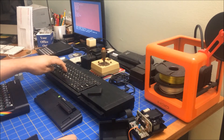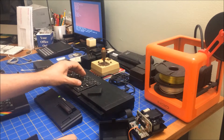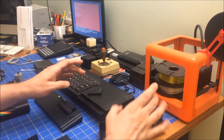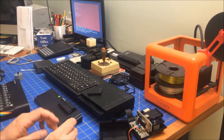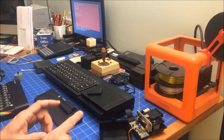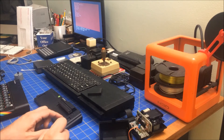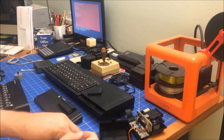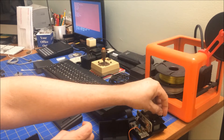So I'm going to format MDV3, call it 'blank', and hold it down just to make sure. Sometimes it'll get skewed. If this can actually format, maybe these drives could read that format and at least show me it's working somewhat. The issue with the QL is that if the Microdrive falls below a certain number of sectors it's a failed format. On the ZX Interface it's not the case — you can actually format like one or two K, which is interesting. Let's put the sheet of paper back in to see if it's just an alignment issue.